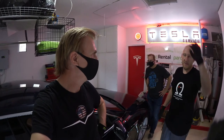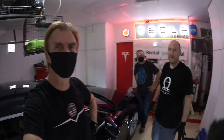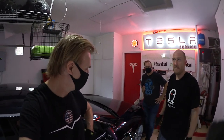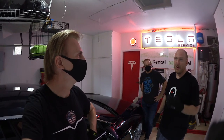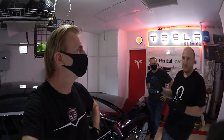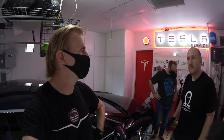In Arizona, it's probably at least every other year. And your battery lasts much longer. There are a lot of advantages, as you heard, for that 12-volt battery. We've been installing them for almost 5 years now. We don't have any batteries that have failed from old age. The only failures we've had so far are from initial installs with some cosmetic damage or broken terminals from shipping. But we haven't had any warranty returns yet.